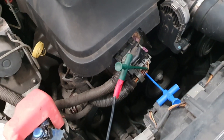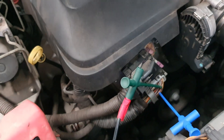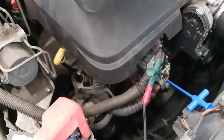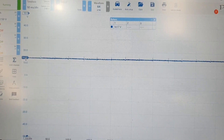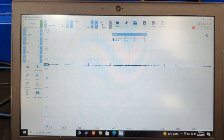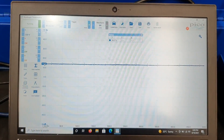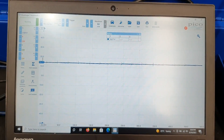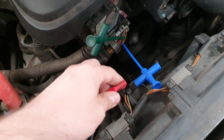I've got it set up and running. I'm on the number 5 injector command wire and also on the number 3 injector command wire so we can compare. On the number 5, our failing injector, we have got battery voltage — that confirms the wiring is definitely intact. However, we have actually got no command from the computer at all. I'll plug into number 3 and show you what it should look like.